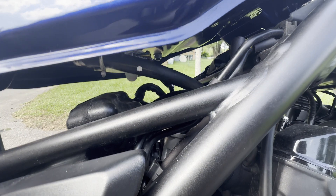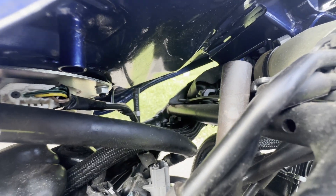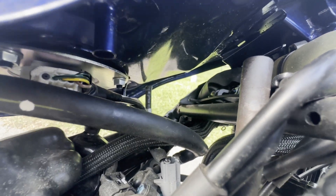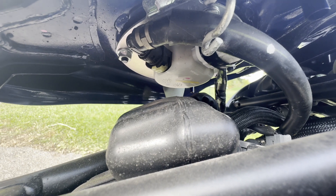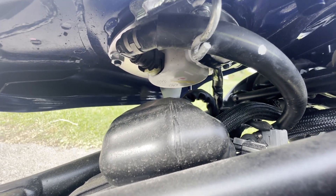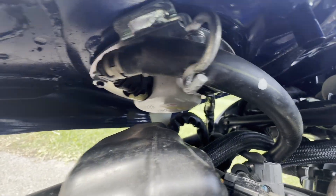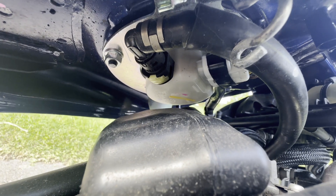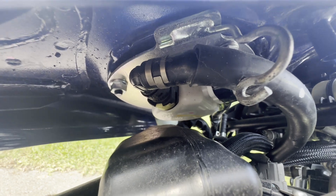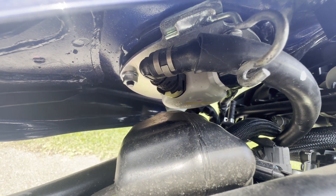Here are the hoses that I got off. You have your vent hose which is right here, there's another hose on the other side that's a vent, and you have your electrical connector and your actual fuel pump supply line that goes down to the intake. The only thing I got left to pull off is that clip and this one, which I've heard can be a little bit of a booger — it's got these little clips that come out and then it just slides off.